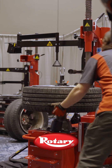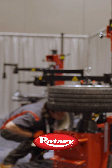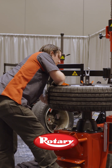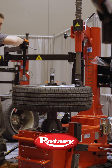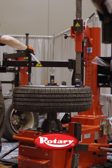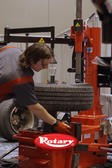Get that bottom bead. Same thing for the bottom — we're going to use this to loosen the bead a little bit. Now for the fun part, the pry over. Use this to help push into the drop center. There we go — bottom bead reseated.